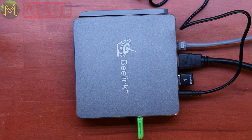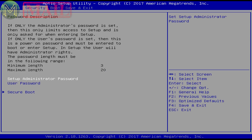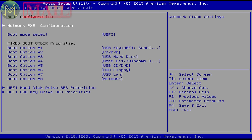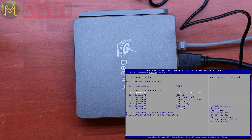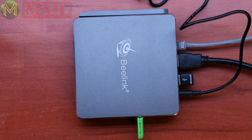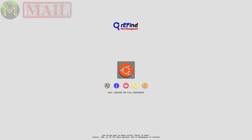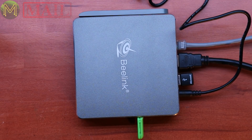Let's see how I can get into BIOS and see if I can install Debian Linux. The BIOS is fairly basic — all we have is secure boot setup and an option to change the boot disk. Very basic BIOS. So I wasn't able to boot Debian. I suspect that's probably because this is a 32-bit UEFI BIOS and it just doesn't boot the 64-bit UEFI. In the end, I used rEFInd to boot Ubuntu and that worked without issue. I could have installed it straight away, but I chose not to — I wanted to keep this box as Windows-only boot. Let's crack it open and see what it looks like on the inside.